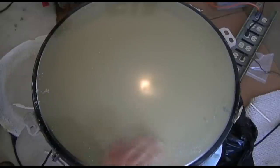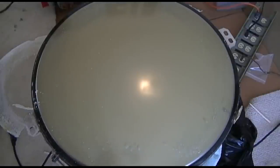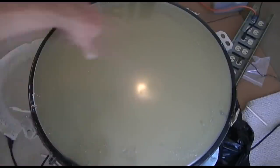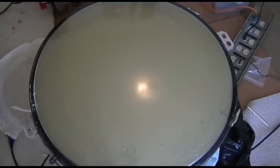Now I'm going to let this cool off for a little bit — I'm not going to mess with it while it's hot. The next step is to clean this all up. You want to keep your safety gear on the whole time — face shield, eyeglasses — because these things will implode, and it doesn't have any safety glass on it anymore. It could be very violent and really hurt you. One reason I left the strap along the outside is that it will help it not implode and will add some strength.